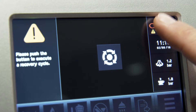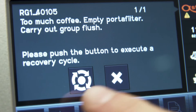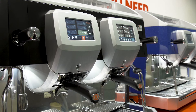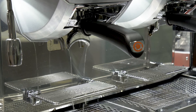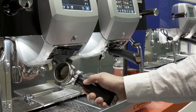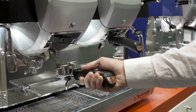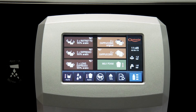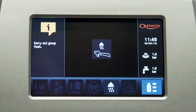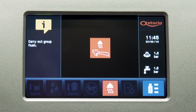After pushing the icon, execute a recovery cycle: remove the filter holder, empty it, and clean carefully the inside of the brewing group, to avoid any coffee powder falling into the cup on the following brewing cycle. At least once every hour and every 20 deliveries, it is suggested to select the Rinse icon to let some water flow through the group head and clean the filter holder. If the periodic alarm has been set, after a certain number of deliveries, the user is required to carry out the flush.